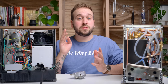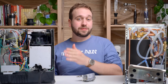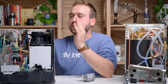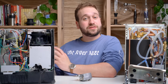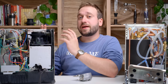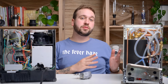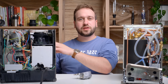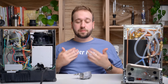The biggest problem comes when we want to switch between brewing espresso and steaming milk. Because we only have one heating element, the temperature differences for brewing versus steaming are very different. Whenever we want to go from brewing espresso to steaming milk, we have to flip a switch — on the Breville it's on the side — and that triggers the heating elements to go even hotter. It can take between 30 seconds and a minute to get the water up to steaming temperature.